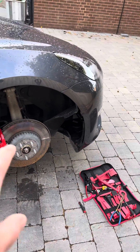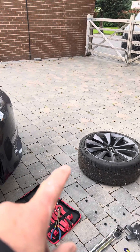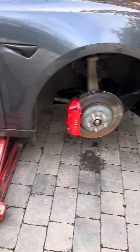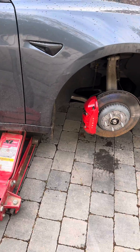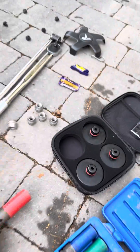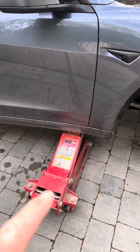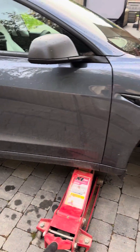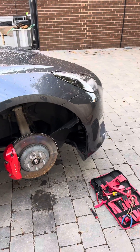Make sure you put it to 175 Newton meters, which is about 126 pound-feet of torque. When it's down, make sure when you take your jack out you take your puck out, because they stick due to the little rubber rivets. They're available on the Tesla website. Do not jack it up underneath or you'll put your jack through your battery and end up with a big fireball. So yeah, that's it — any problems, give me a bell.